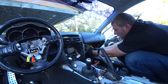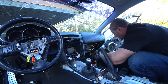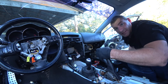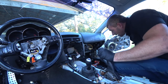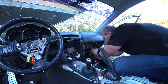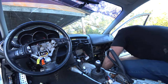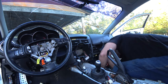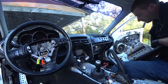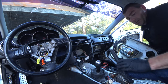The yellow cable indicates an airbag or safety restraint system — so your automatic retracting seat belts and everything like that will be labeled yellow. We just need to disconnect this. That did it — step one down. Let's get to the rest of this dash.